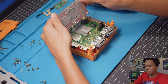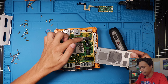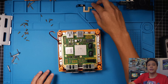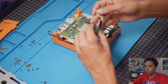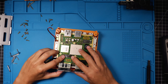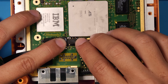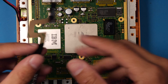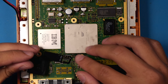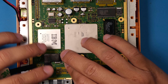Now this is what we're looking at. The first thing I usually do is unplug the fan. As you can see, there are four screws in the front, and then about 15 screws around the sides and the back — this is where having a little electric screwdriver definitely comes in handy. There are two screws on the sides for the fan, and the fan should just pop right out once you get that screw loose. Just feed the cable out and set the fan aside. That should lift right up and you can set that aside.